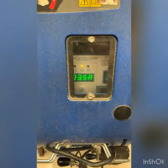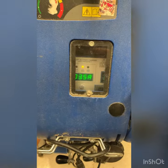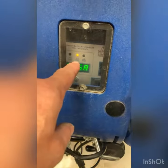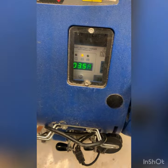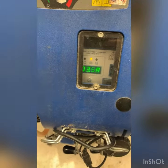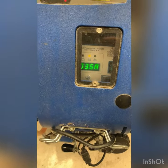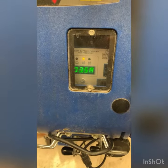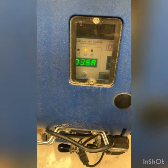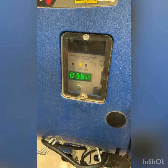I just wanted to check to make sure the charger is working, so I plugged it in. Within two minutes we're already halfway charged — even though we're not. That's another sign of sulfation of batteries: the rapid recharge of a battery pack. When they're really depleted and discharged, it should take much longer; it should still be on the red, which is the bulk phase of charging.